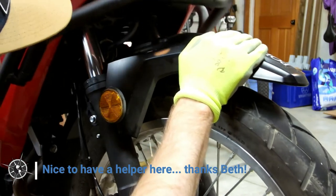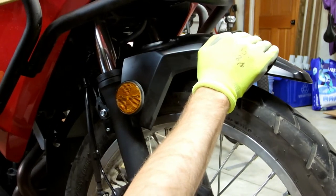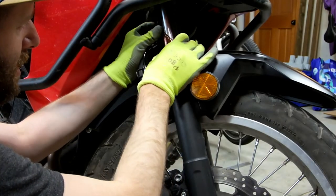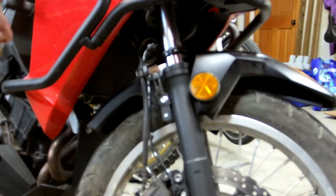Once we've cleaned it all out, go ahead and pump it a couple of times to see if anything pops out. It looks perfectly clean, so I think we're good. Last, clean the dust seal, get it all nice and shiny, and then slide it back down.